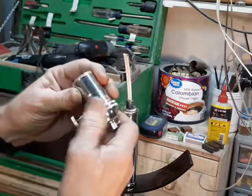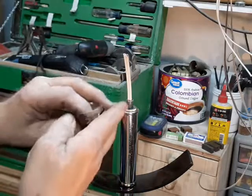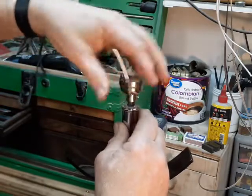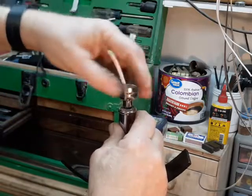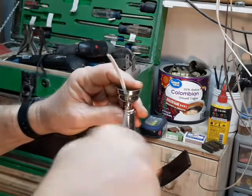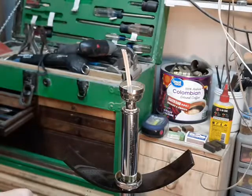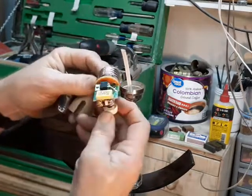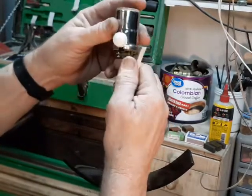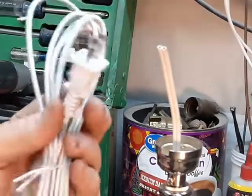The saddle is going to be abandoned because the customer wants to use an ornamental globe type bulb. We're going to be using this nickel plated socket — I like these because they don't snap together. This ring captures the top and holds it in place, and with the screw in the thread I can set it to wherever I need it to be without worrying about it not being completely tight. I'm not going to use the switch that came with the socket shell — what I have here is an electronic dimmer socket interior which will go right up in here and install in place of the old one.